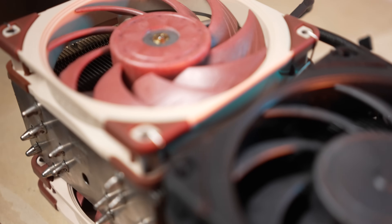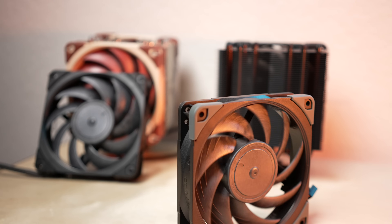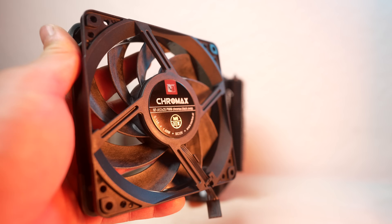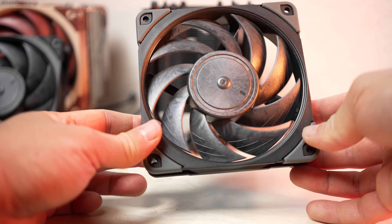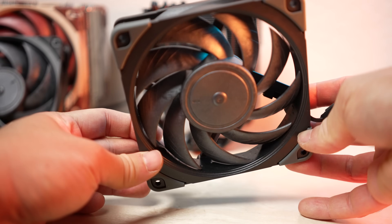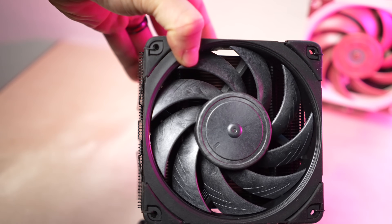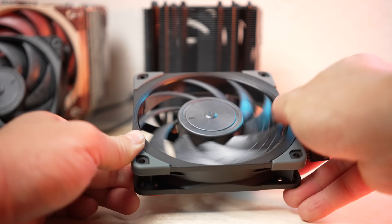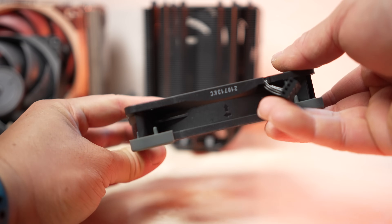Let's take a look at the fans — they're a little different. Other than the color, the hub looks a little different on the Chromax version compared to the tan and browns. The cable on the standalone version terminates close to the frame for use with a provided extension cable, similar to other Chromax fans like the Chromax NFA 12x15. Looking at the blades, it's a similar liquid crystal polymer Sterox material comparable to the original brown blades — not jet black, more of a mottled dark gray — and they still have that same luxurious thick substantial feel. Very solid axle, no wobble, and the bearing feels buttery smooth. The serial number is stamped on the same side the cable exits, so if you're trying to hide the cable, you can also hide the serial number.